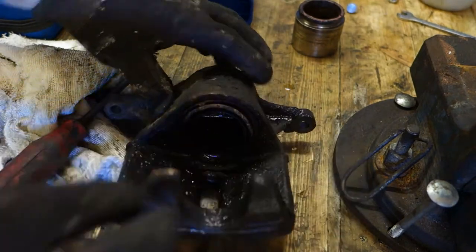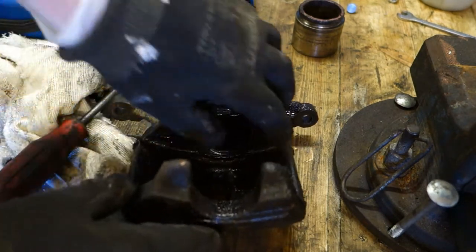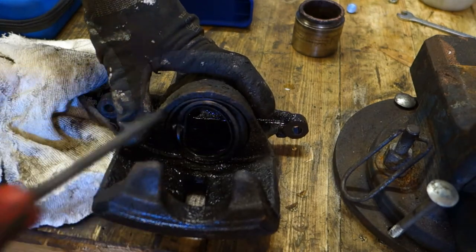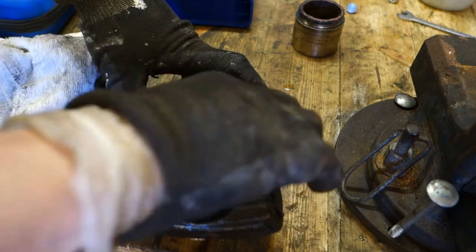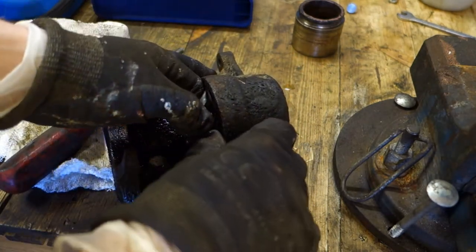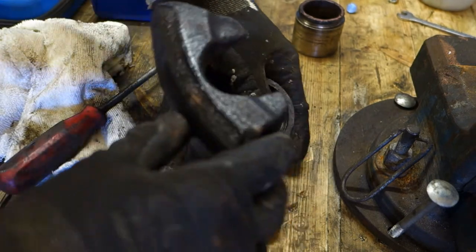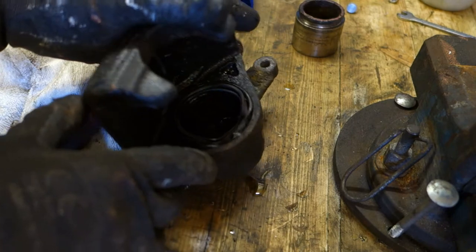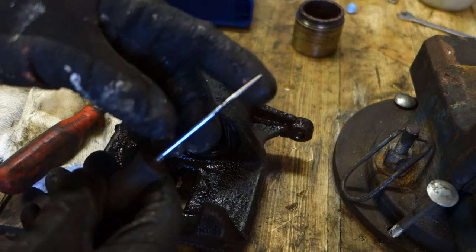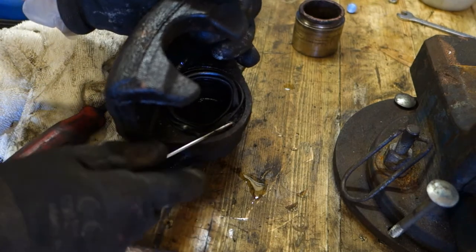Okay, then when we look inside this cylinder, first we can take this protective boot away, and it opens so that we carefully move it out this way. We can purchase these rubber boots, new ones, at the nearest Toyota dealership center, and it is important to take it out so that we can look in there. And by the way, there was this metallic pin. And for that job I now need this sharp head tool. There is a sharp spike that goes in here. And there is this metallic locking pin in here, and soon I will open that.